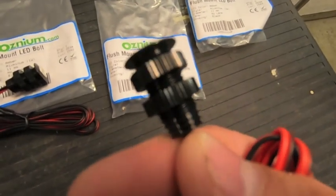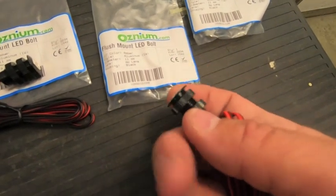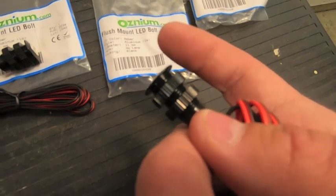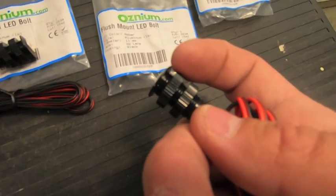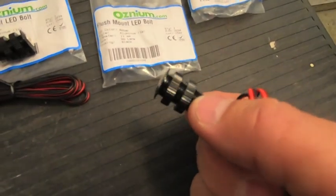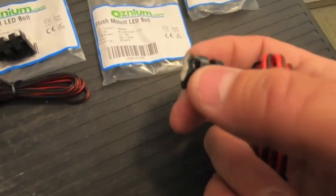What you get is the LED bolt — it's essentially a threaded body with two nuts. You have the option to put the first nut up against the rim, or back them both off and use one nut to affix the LED bolt to whatever material you're attaching it to, then screw the nut behind it to tighten everything up, using the second one as a tightening nut.